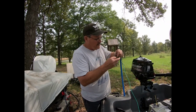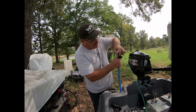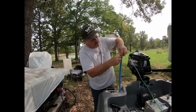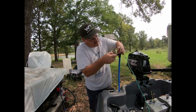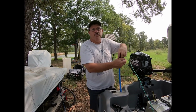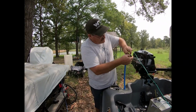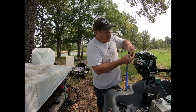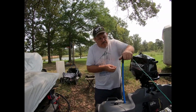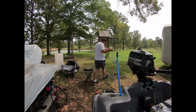And if you've never done this before, I'm sure you have, but for the interest of doing it, we always tape and then pull over, lay it over, and retape. The reason why is because you can pull this wire or your pull rope right out of your tape, and then you have to start all over again. So pull it down so there are no obstructions. Tape it on good. Go ahead and waste some tape. Don't worry about it. All right, now that's ready to pull. So what I'm going to do, we'll lay everything out so it's nice and straight.